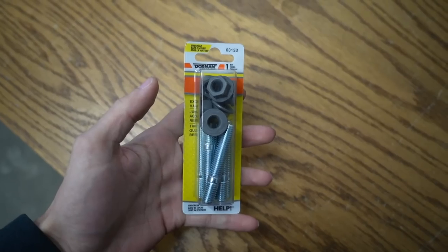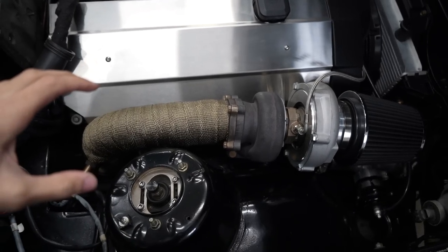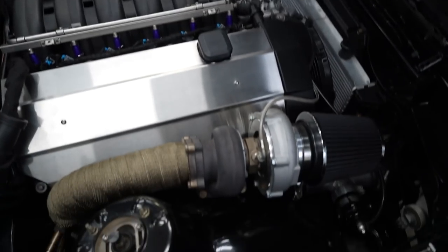Both wheel bearings are finally done. Now I've got to put the turbo assembly back on. I went to Advanced Auto — shout out to Ray — and got another stud kit for the turbo. The one I ordered was the wrong thread pitch; hopefully this one works. It's a little long so I might have to cut them down. I was trying to get the exhaust on off-camera but it was not working — it doesn't like fitting now with this cover, and just how I made the downpipe wasn't really accounting for it.